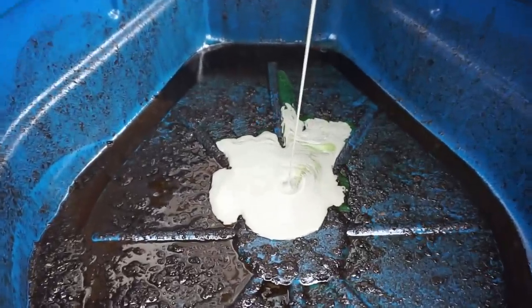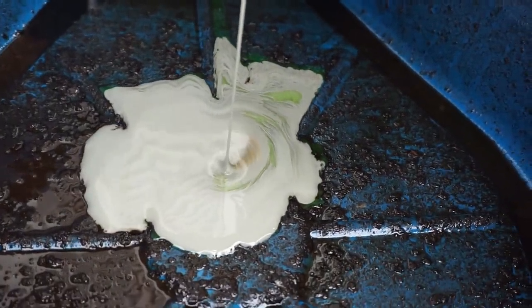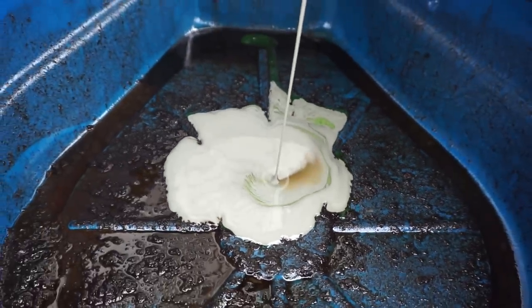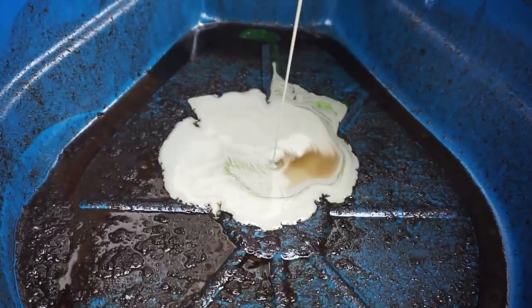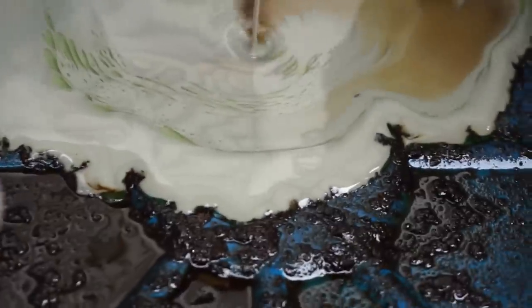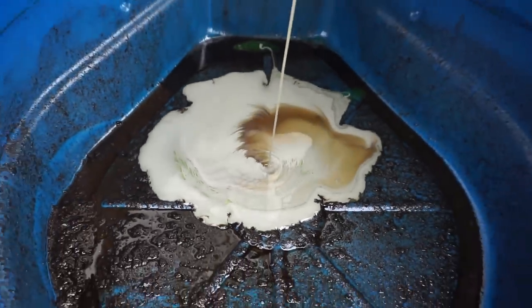All right, guys, so take a look at that. You can see coolant clearly coming out. There's that green liquid coming out, so obviously that is not good oil. That is super milky. Holy cow. That's crazy. Then you can see the green coming in there. That's awesome. Oh, there's some regular colored oil. That's probably from the bottom, though. Yeah, so that's not looking good so far.